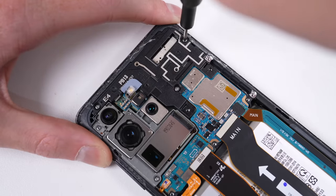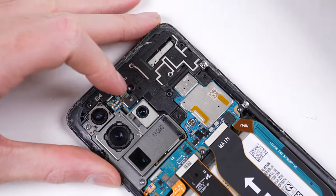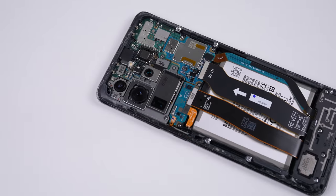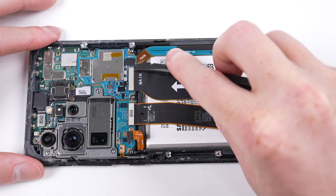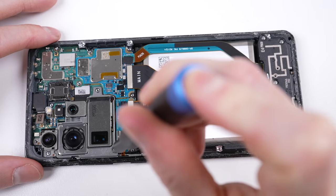Next is the upper antenna. Samsung has been a bit sneaky and hidden a screw right next to the LED flash. With a proper look inside the S20 Ultra, we can see that it resembles both the layout of Samsung's phones before and after it. The most notable difference is the amount of space taken up by the many cameras, especially the ultra zoom lens.